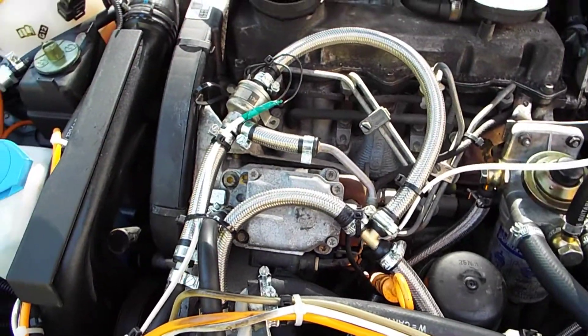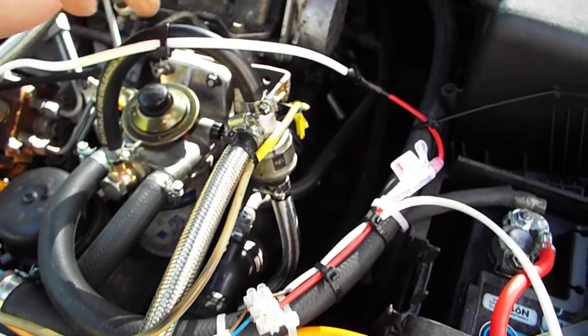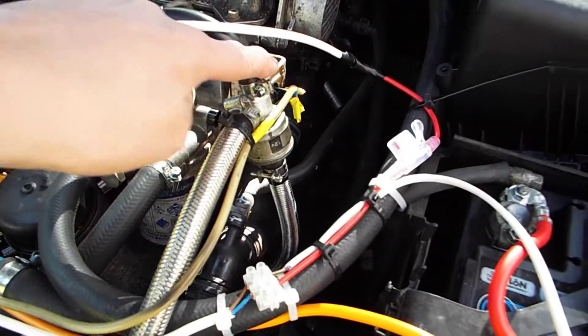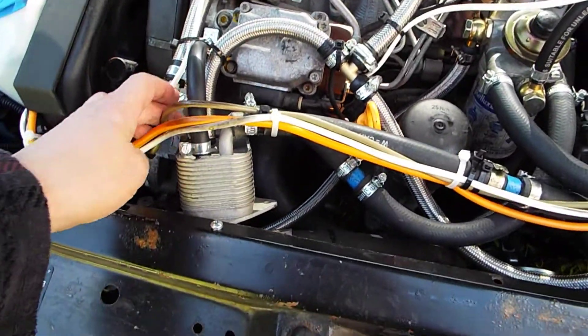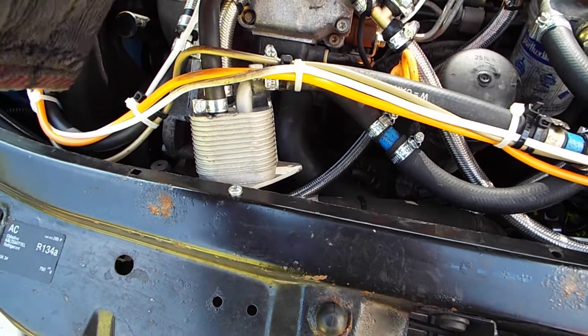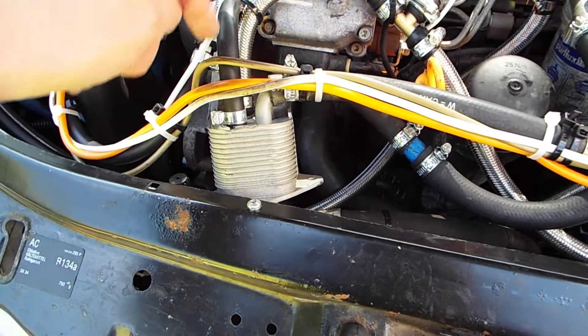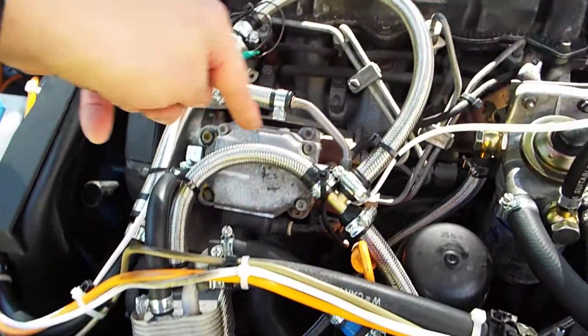As soon as the engine gets hot, the switch in the cabin switches to vegetable oil. The warmed vegetable oil will now flow here, out of here, into the heat exchanger to get heated up to 70-80 degrees, and into the Bosch filter, then round in the loop. And that's it — off we go, round and round.